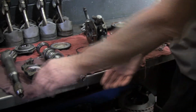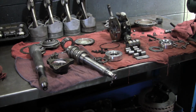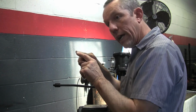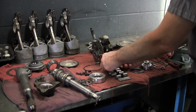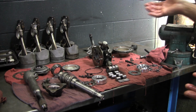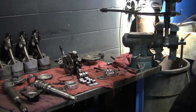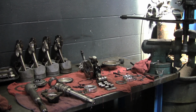What happens when you're turning the steering wheel and you're at the center position, which is that tight spot, which should only be maybe a half inch span on the dial, is that it's applying pressure to move this one way or the other. Once you get past that, especially in those loose sections, there's no pressure on there because it's already been pushed, and it'll hold it over there. But when you come back to center, it centers it. So that's a Silver Cloud 2 steering box.